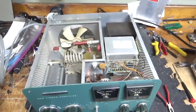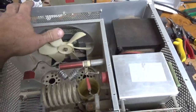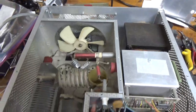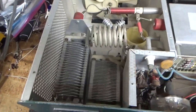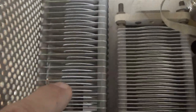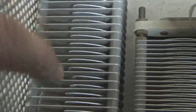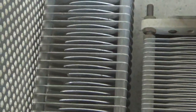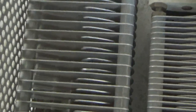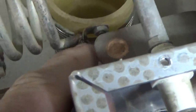I'm going to go over everything I need to do real quick. I already did some pre-tests. It needs a new fan motor — I turned it on and it was really noisy, so I'll replace that. It also needs a new capacitor on the plate side. You can see the edges of the metal here are pretty melted and sharp and burnt up, so I'll change that out. There's also a solder joint that's bad over here.